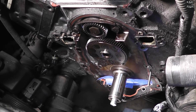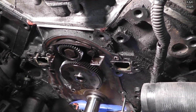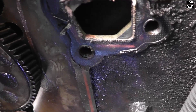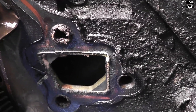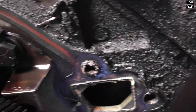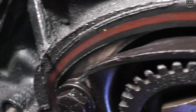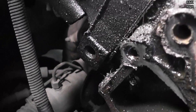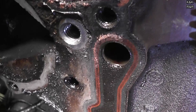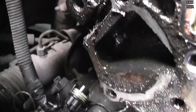Welcome back. We're going through the cleanup of the timing chain service. This did start out as just a timing gasket job, but there's no reason to go in this deep and not do the chain. The water pump side of the timing cover to block is a real bad leak point. This gasket is plastic with a little bead, and you can see the bead is now gone — it's there but it's not sealing. The oil control side has water flow and oil pump feed line pressure, which all becomes a major leak point and will eventually catch a car on fire. I've seen about ten of them in the junkyard with this engine.